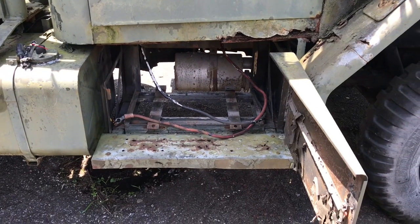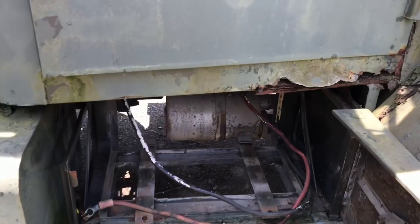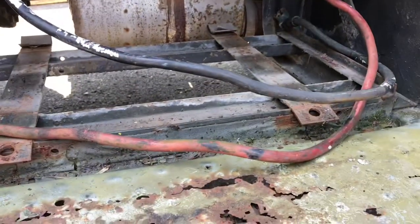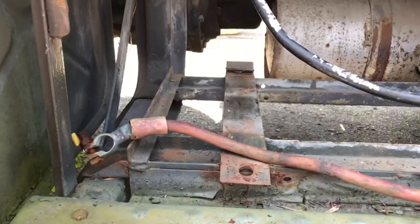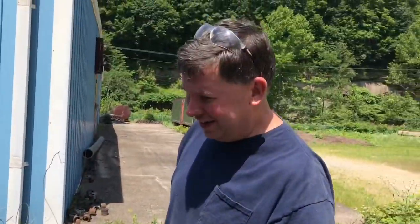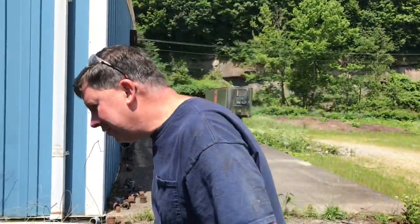That's good. All right, so Chad did an excellent job patching in some cables here. Just happened to find some battery cables on an old reefer that was due to be scrapped anyways. So those were liberated and he did a nice job. Nice work, Chad. A couple bolt splices off this scrap pile over here, and we've got the wires back together now. And a little bit of tie wire to keep the battery cable off the muffler, and we're good to go.